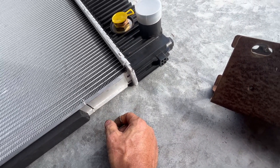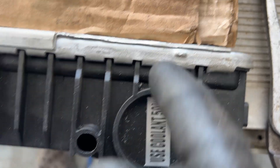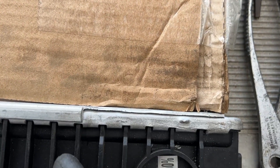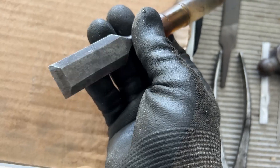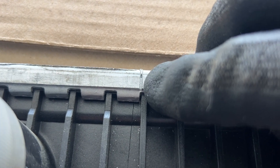Why is it always something? Okay, that was not so bad. I took my Dremel to cut that mostly through, and then I did the same thing along this edge. Then I used a carpenter's chisel — which I've downgraded to a gasket scraper — got up underneath it, bent it, and it just broke off. Then I filed it clean. Over here I switched to the hacksaw for better control, and I already cut that.